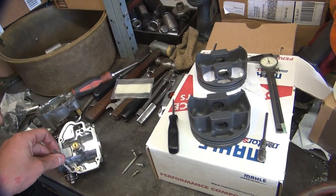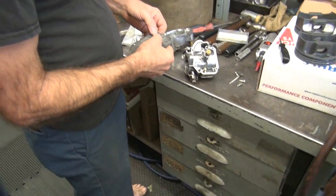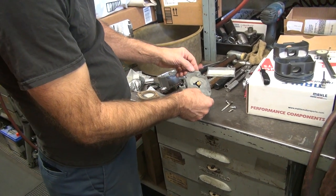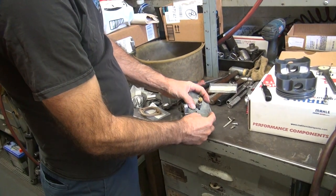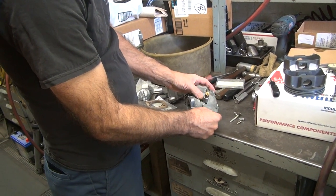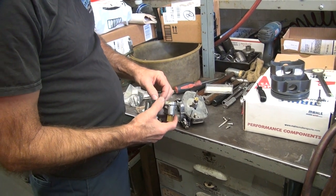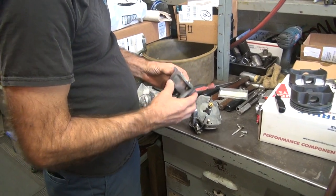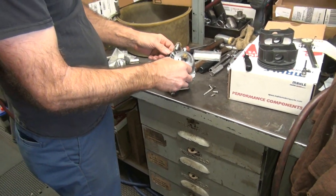Okay, so how'd you come up with this jet? It's been in the bike for probably a thousand miles. And how does it run for the last thousand miles? It saved me a lot in gas. I doubt that — it's probably so stinking lean it won't run. That's why it was always hard to start. Where's your new O-ring you're going to put in there? You forgot it upstairs. I told him you didn't need one — you said it's runnable. I'll be upstairs.